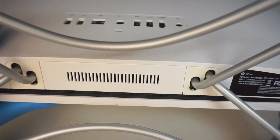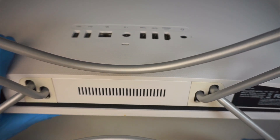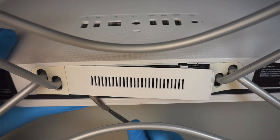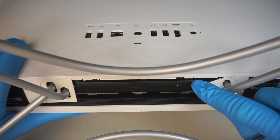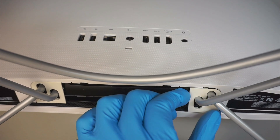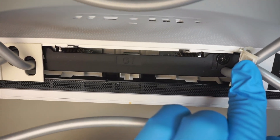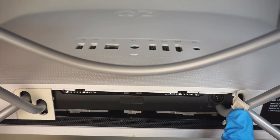Let's get started. The first thing I like to do is remove the cover right here. I'll be using a metal prying tool to go underneath and pry it open. Then you want to lift up that little rubber piece to expose the screw which is holding down the stand. The rubber doesn't come off, so just move it around and peel it to the back — you can see there's one screw right there. Let's go ahead and get a Phillips screwdriver.